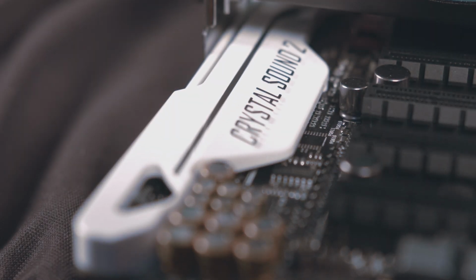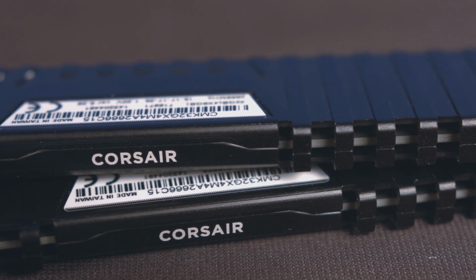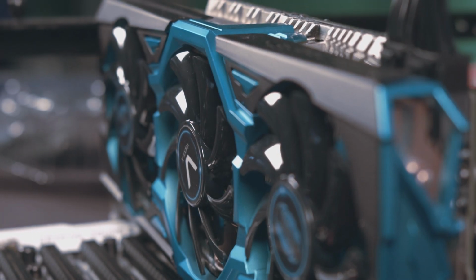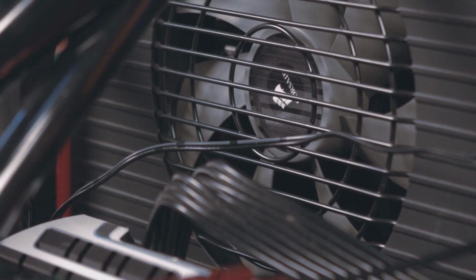All right. So we threw the chip into an ASUS X99 Deluxe motherboard with a Corsair AX1500i power supply, 16 gigs of Corsair DDR4 Vengeance LPX 2800 megahertz memory, a Corsair Neutron 128 gig SSD, and a Sapphire Vapor-X R9 290. That's the test bench we got going here. It's running Windows 8.1 and is cooled by a Swiftech H220X for kind of the best possible non-full custom water cooling loop type performance. Now, NCIX Anthony ran two synthetic benches, Passmark Performance Test and Cinebench 15.